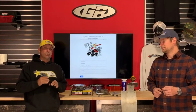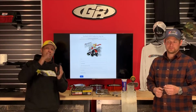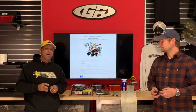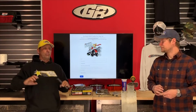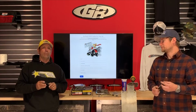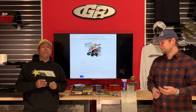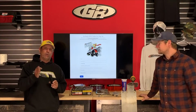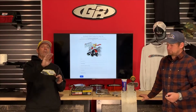So just be aware that you're letting the engine ramp up and get into its peak horsepower and torque so that it's really nice to drive. The other thing is the more horsepower you have, you want to be able to ease into that so you don't just blow the tires off. And that's a real challenge. So you want to get that higher stall, and you'll find that it's a lot easier to drive. If you're not sure about that and you ever have a chance to ride with me, you will be amazed. Every single person that rides with me is amazed how smooth my vehicle is, how smooth the power delivery is.